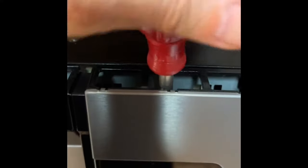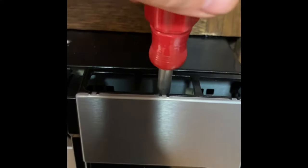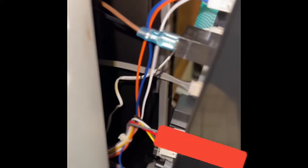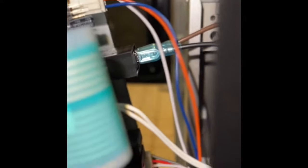Once the screw is out, you just need to lift up on the control panel. You want to use a magnetic screwdriver so that once the screw is out you can lift it out, because you don't have good access with your fingers. You can even take a regular Phillips head screwdriver and expose it to a magnet for a while to magnetize it. Lift up now on the big plastic control panel, then pull the front of it toward you gently and slowly.